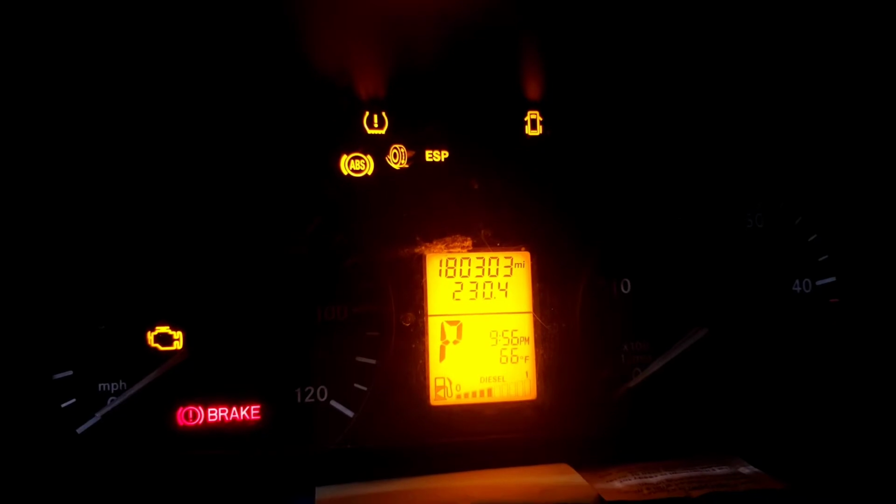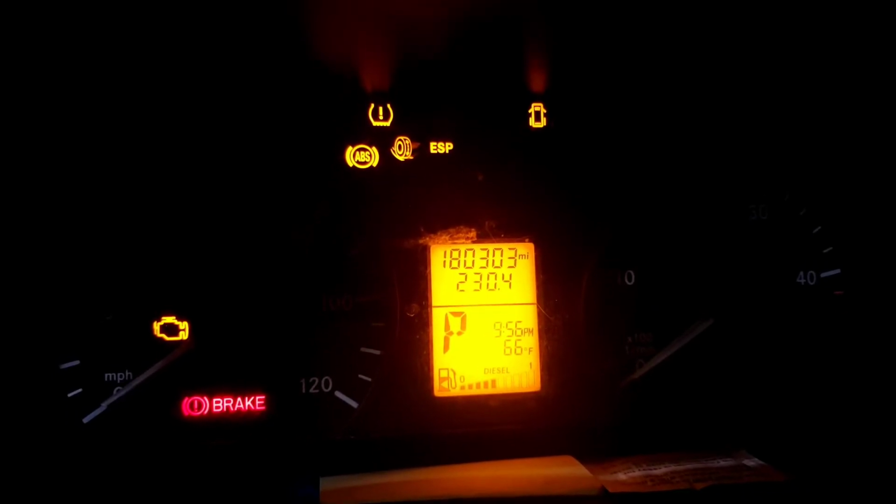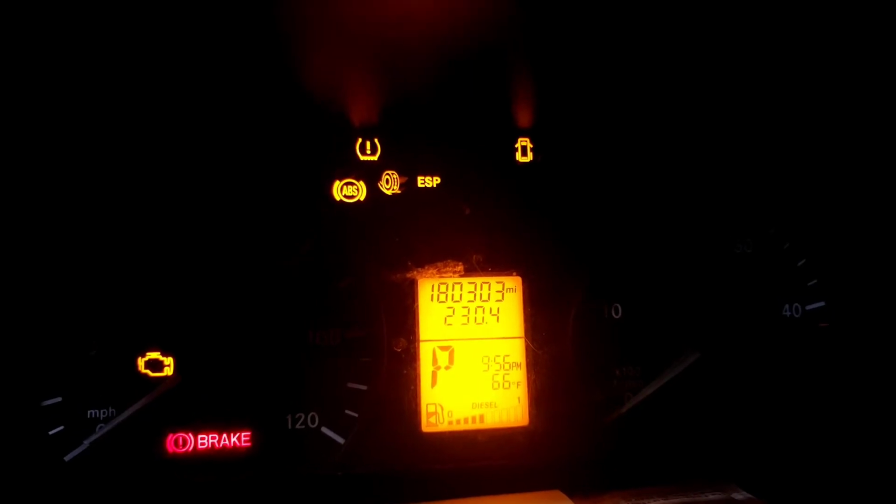We're already 2 minutes into it, so I'm gonna show you exactly the issues that I was having. Also, almost forgot to mention the brake pump, a solenoid on that. I checked fuses and checked for corrosion at the connectors and plugs for the pump that's up front. I gave this thing a complete overview of the electrical system, thinking it could be that. But here's the problem: that brake light wasn't on the entire time until I finally found the problem. So as you can see, the ABS, traction control, and ESP lights are on.